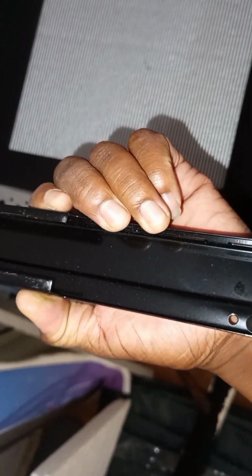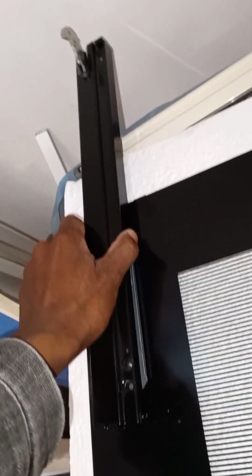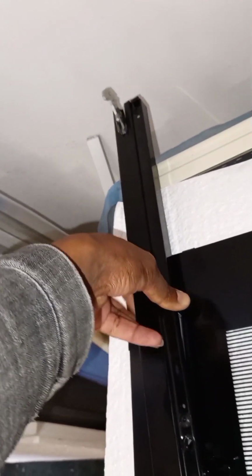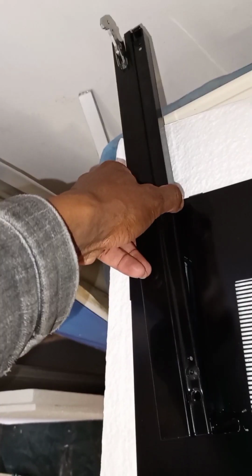So in a moment here, we are fitting the outside glass and the inside glass for an oven door. So this one, it's like you're building it from scratch. You disassemble everything. The new glass comes with a clip glued on it, so we must fit this. This is for the left side. What we do is we try to clip it and push it up. What we do on the left, we also do on the right.